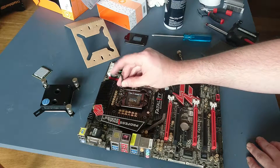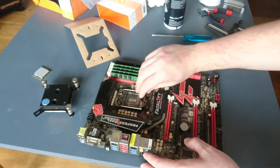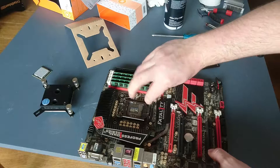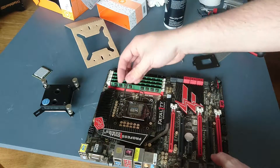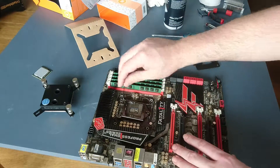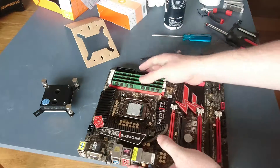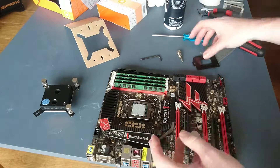What you have to do is uninstall your motherboard retention backplate off the back of your motherboard. They do give you all the tools you need to do it, but the opportunity for someone to accidentally slip and potentially damage a pin is absolutely huge. I'm going to get this CPU back in here as soon as possible because I don't want to damage any pins. The backplate is done now — it's easy, not a complicated process.